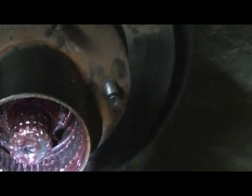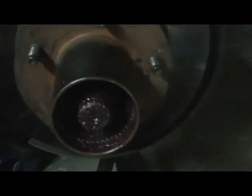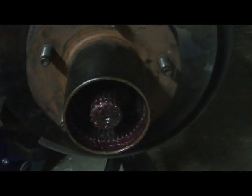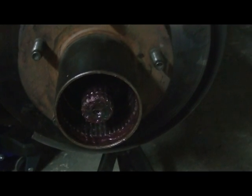Alright, so I got the lock nut for the bearing adjusting nut, is what I call it. And it's on, it's in there, pin facing me once again. And you can see the hub is free to spin. What you don't want to see is any play, any wiggling around with the nut where you want it. Some people go ahead and put the tire on, give it a good shake, make sure you got nothing happening as far as it being loose or where it causes some vibration.